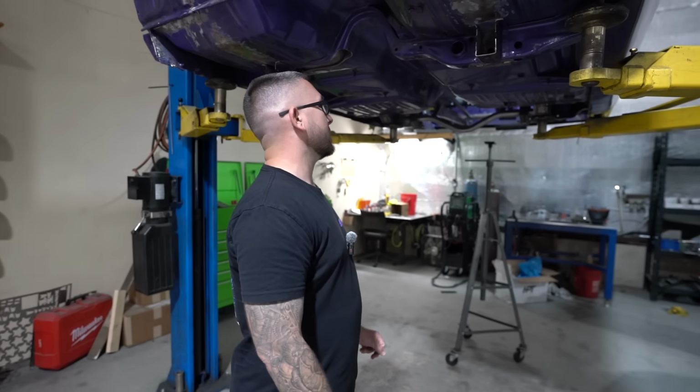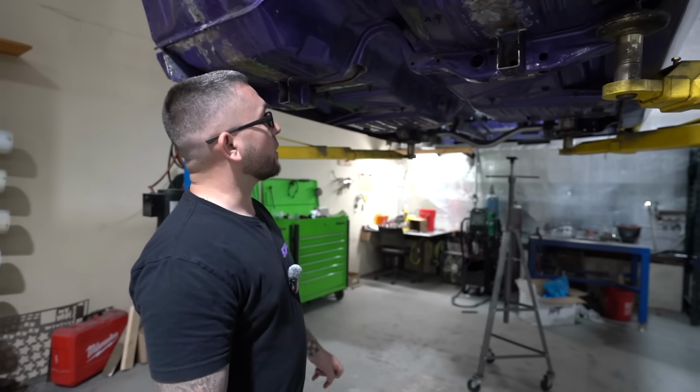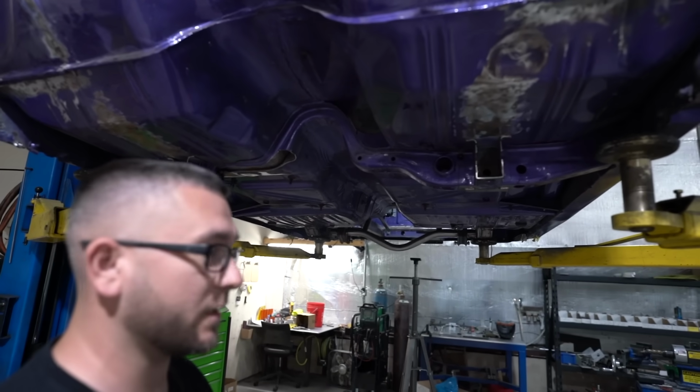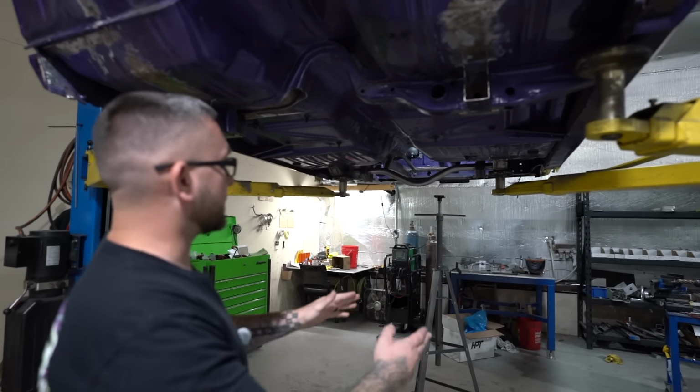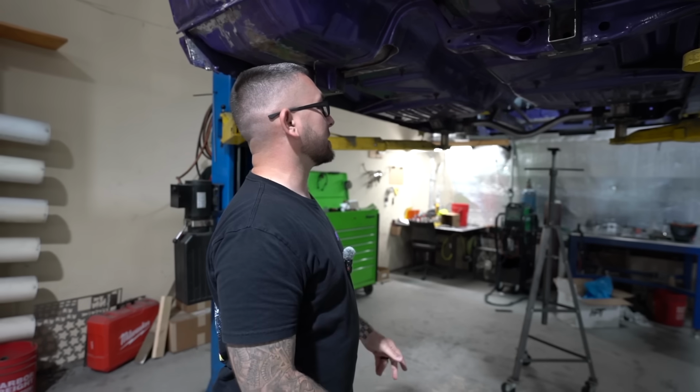So the next problem is, when we cut all that out, the Tremec is not gonna fit great in this tunnel. So you want to make the tunnel a little bit bigger. The problem you have then is trying to tie a nice tunnel into all this ribbed factory floor stuff is an issue. And the factory tunnel is offset, which our rear end is not offset. So we moved the tunnel, and then the next thing you have is the floor doesn't match the tunnel good, and now you want to cut the floor out. So we had to get with Jeffrey, and he had to think for a few days. And he pretty much said, do whatever is going to work best.